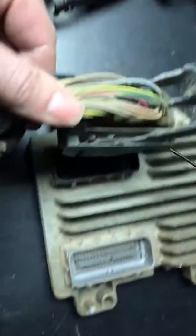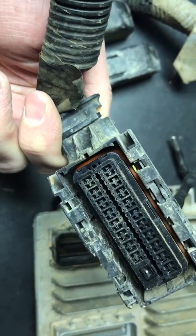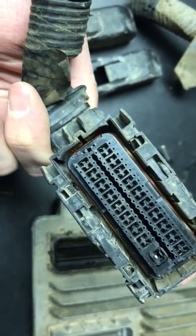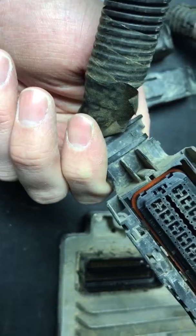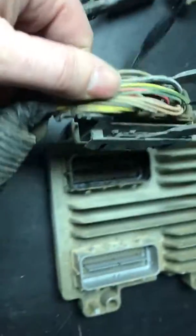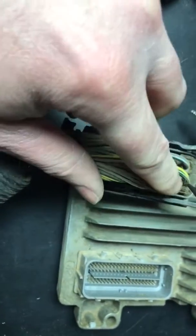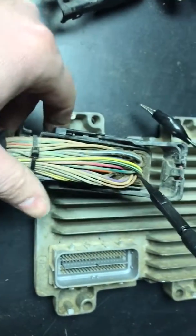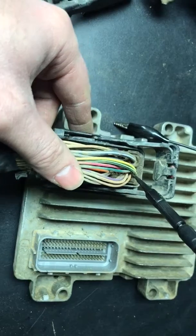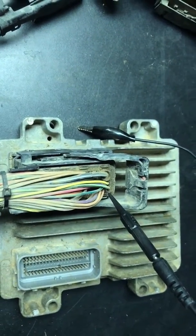What you want to do is go into the black connector. If you look in the back you probably won't be able to see it, but the pins are marked at the very edges — there it says 53, and there should also be a one somewhere. You're going to go to pin 50 in the black connector, which is up here — the green and white wire — and that is where you're going to test for voltage: either constant voltage, cranking voltage, or for three to six seconds with key on.